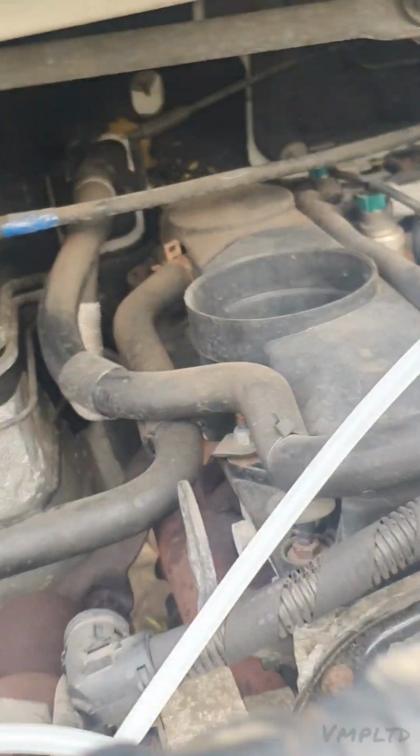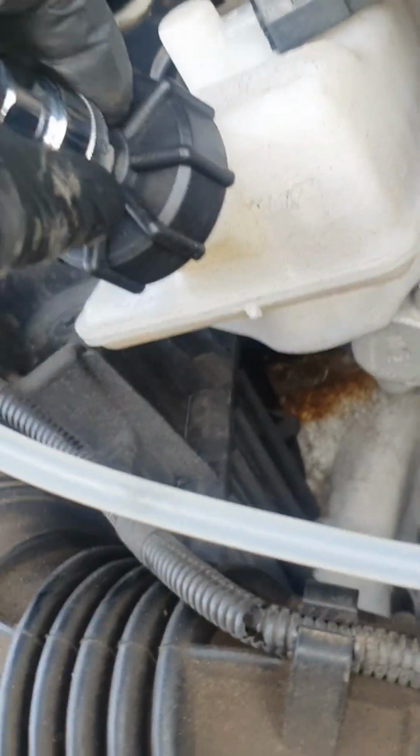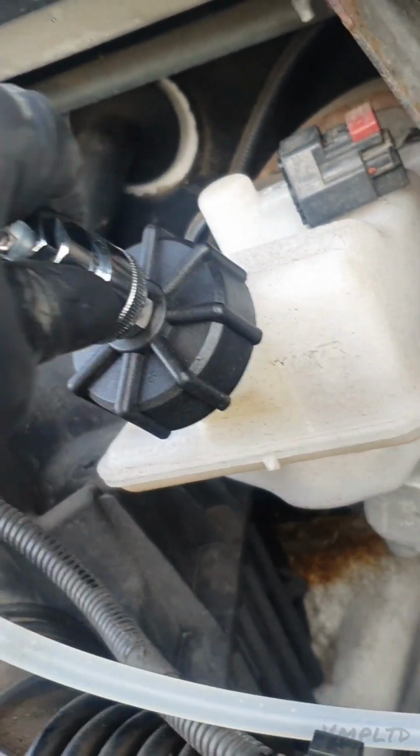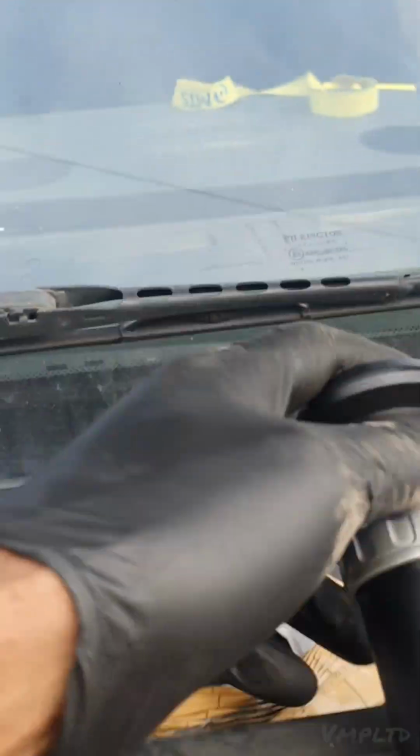So you just want to connect it up. You'll want to fill it up with brake fluid. I haven't filled it up; I've put some in because I was just testing it. Fill it up through here, the filler. Connect it to this cap which comes with it, which is just a simple airline connection. Make sure that's tight, and then obviously you pump using that.